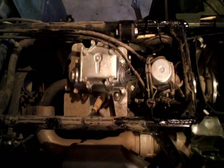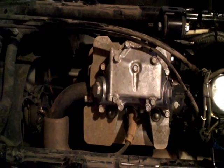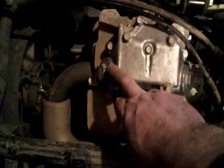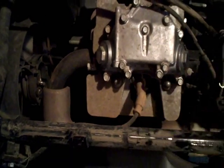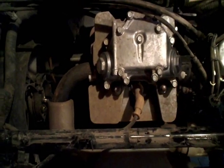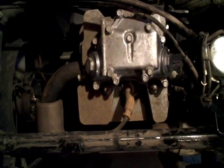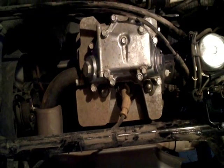Okay, here is the elusive top of the motor. I mentioned that most of the work was getting all the body work and stuff off. So now what we need to do is clean the dust off around these two caps, which I've already done, and pull down. It's a good time if you want to inspect your spark plug or change it to pull that. Before you take the spark plug out, blow some compressed air around there. You don't want any dust or little particles or anything getting into the cylinder there. It'll cause wear.